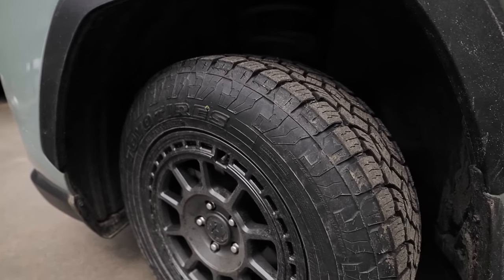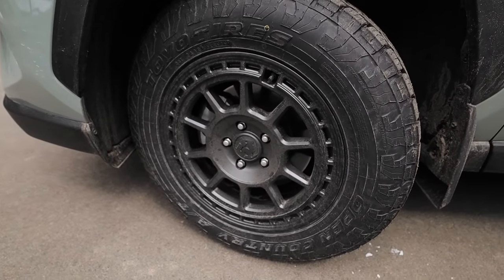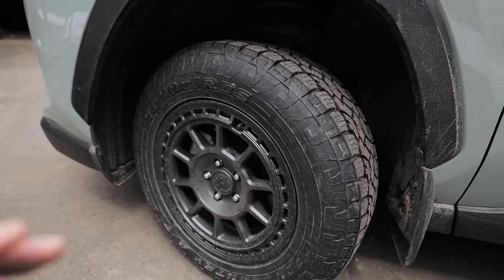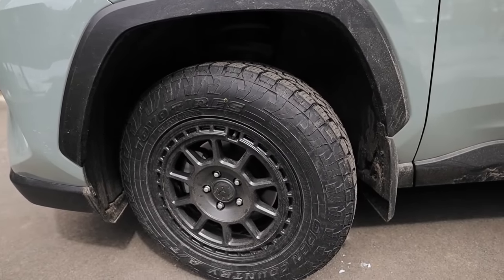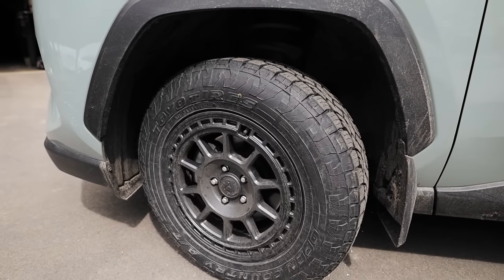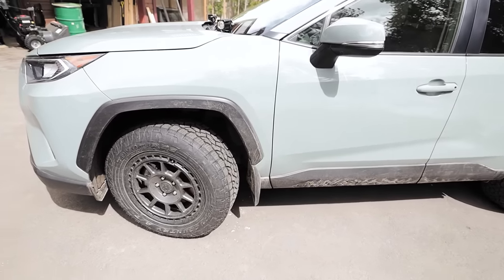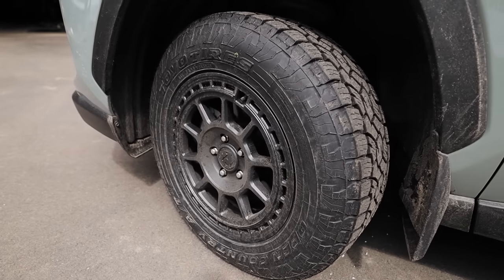So these Toyo tires are brand new — they're advertised for light truck and CUV, which is a compact utility vehicle or small SUV. They have a mountain snowflake rating, which is good for where we live. A little bit aggressive. Ashley does like to go hiking, so getting a meatier tire helps her get to the trails she goes to sometimes, but she doesn't do any serious off-roading. They are in 245/65R17, which according to the forums is the biggest size you can fit with no lift. We don't plan on lifting it because this is Ashley's daily driver.